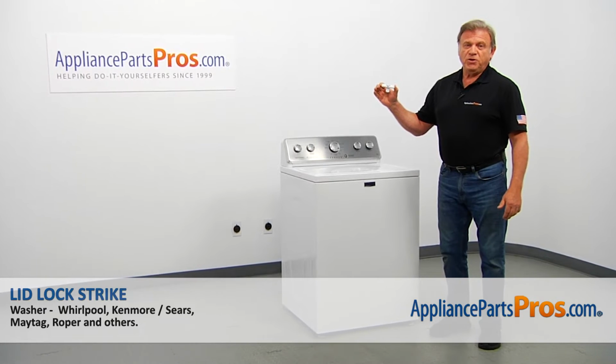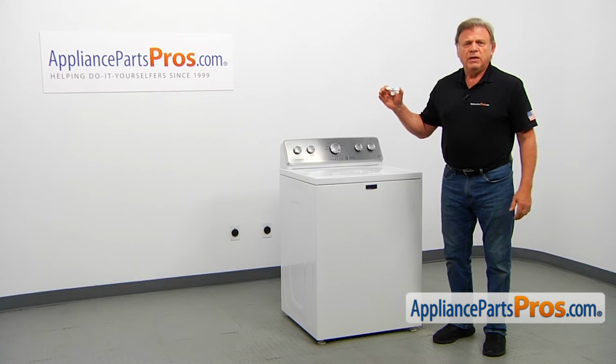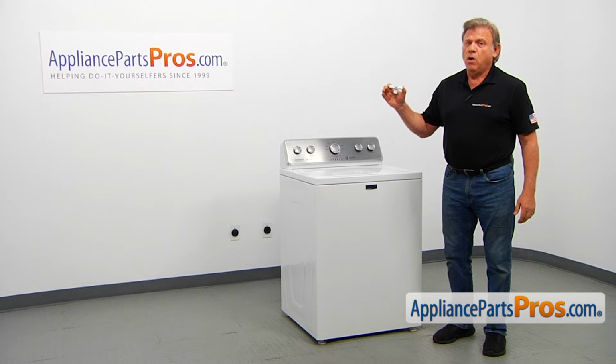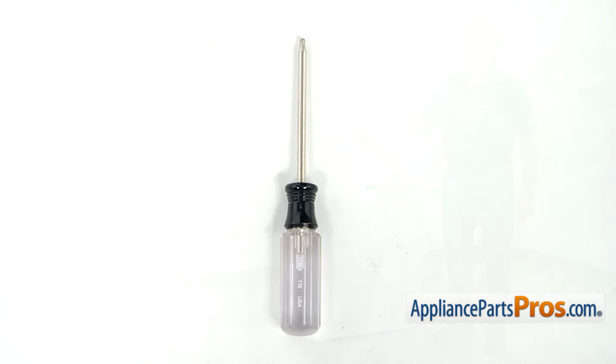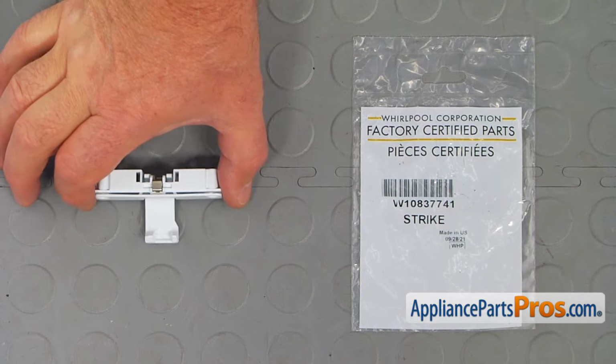In this video, we'll show you how to replace the lid lock strike in a Maytag washer. It's going to be a very easy repair, should only take a few minutes to show you how to do it. For this job, we are going to need a Torx 15 screwdriver. When you open up the package, you're going to get a new lid lock strike.